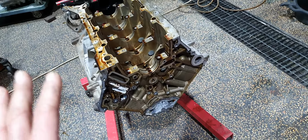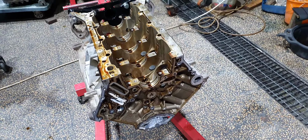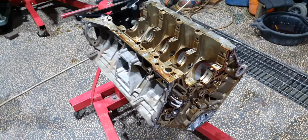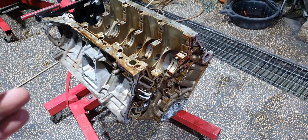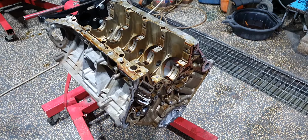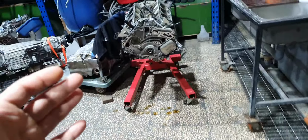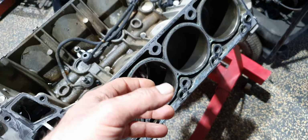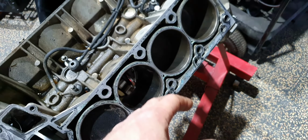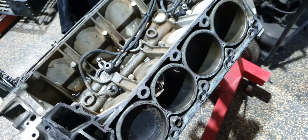A small update for that. Plus, one friendly piece of advice to the people who are saying to force the customer to do it this way. The owner of the car, like I said before a couple of times, I can suggest to him what to do. I can give him some options. There is an option, if he wants just that, I'm gonna try to clean the cylinder bore here with the stones that I have, so it doesn't have the piston material on it, and then put one piston, one connecting rod that I have from inside, one fresh one, close it and call it a day.